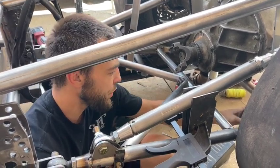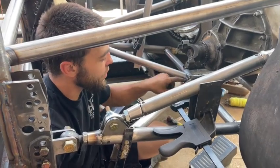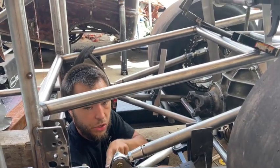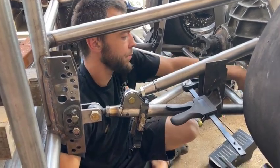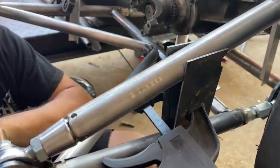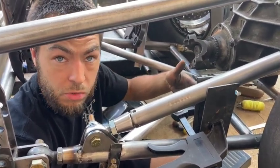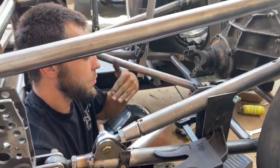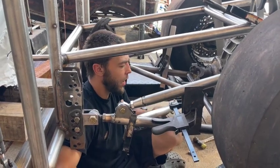Our pivot point is back here on the four-link brackets. When we raise our instant center, these brackets are going to lift up. If the center of the X was here and we lifted up six inches, this point lifts up five and three-quarter inches. If we had the X back further and lifted six inches, it lifts up six inches. If the X was at half the length and we lifted six inches, this point only moves three inches — because it's at 50% of the length. By doing this I changed it to about a fifth of the pivot point location versus half.